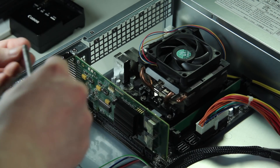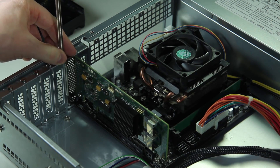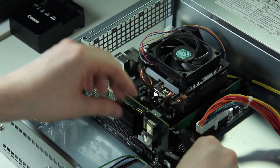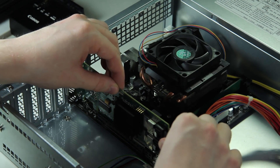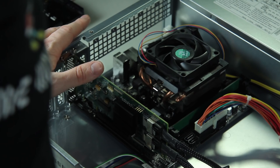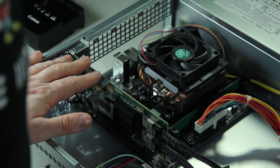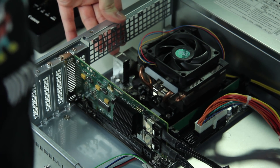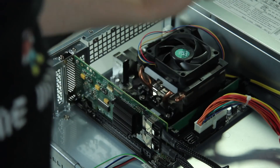Let's use my better screwdriver for this one. And that's secure. That's in and that is also in. SAS cables plugged in — so that means the bottom two rows of four drives is active on here now. I just need to plug in the power, and then we can boot this thing up and see if I can detect everything in BIOS. Maybe throw the one terabyte drive I have over there that's empty in just to see. And we should be good to go.